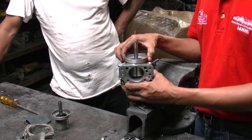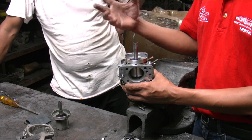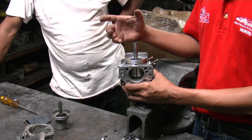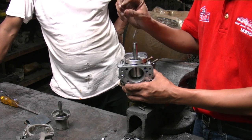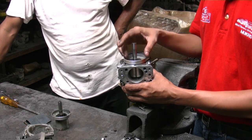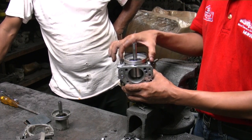And if you wanted a heavier oil, what do you do then? We'll mix a bit with an EP90, which is a gearbox oil. And sometimes one of these engine treatments, which is really thick, mixed with a bit of engine oil so we can really adjust the desired dampening.